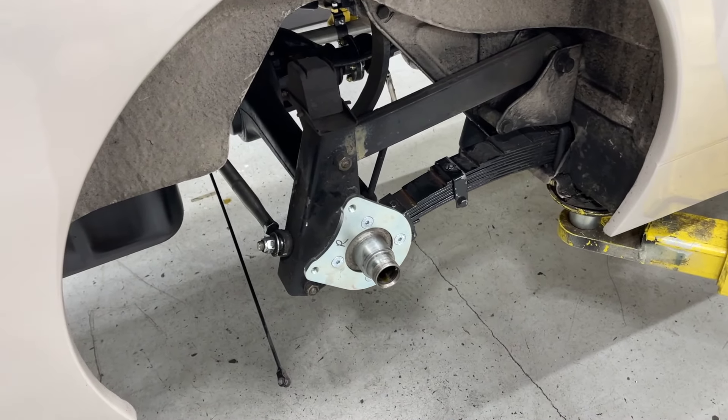There's an aluminum radiator for cooling, and a boost-retard mechanical distributor to make sure we avoid detonation. We've also got ARP studs and an improved head gasket, all to address the slightly higher reliability risk because you have more boost in the combustion chamber. We've strengthened the union between the head and block as a proactive and preventative measure.